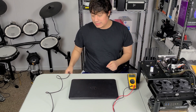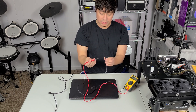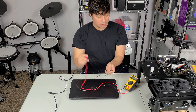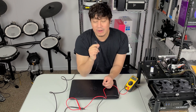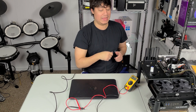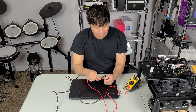The first thing I'm going to do is test the power supply that was provided with the computer, because if the power supply doesn't work then it's not going to turn on. We're going to do negative on the outside of the tip and positive on the inside. The power cord pin inside is bent, so let me see if I can get a reading before I do anything else.